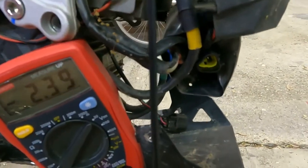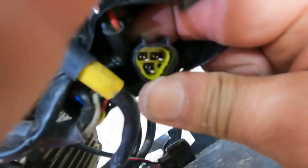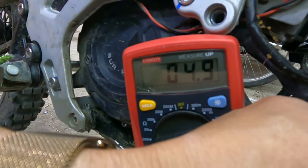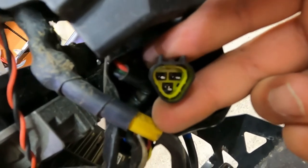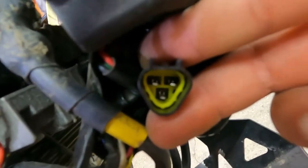The pin that we're going to probe is the top-left pin — that top-left corner pin is the one we're going to probe with the multimeter lead. When I touch it, I get five volts — it's the top-left pin. That checks out. With the display on, you should be able to get five volts out of that connector, and in this test we were able to do so.